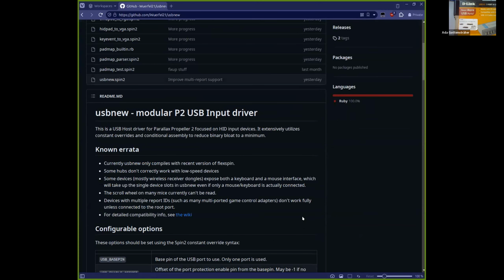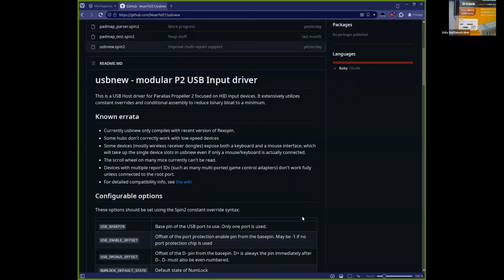Yeah, well, again, multiple game controllers make sense, multiple keyboards. You need to have a specialty use case for that. So for that sort of thing, you need to edit it a bit. The main use case for having multiple is that if you have a wireless mouse with a receiver dongle, it sometimes will enumerate as a keyboard as well, because they use the same receiver dongles for the bundled set of 1 mouse and 1 keyboard and 1 dongle. But they don't disable the keyboard interface on the dongle when they're selling it with just a mouse. So you end up with a keyboard that never presses any buttons because it doesn't physically exist, but it sometimes takes up the slot on the driver, which is kind of obnoxious. However, if you do have a combined device like that, where both the mouse and the keyboard actually exist, then it works. Such as my ever-beloved PS2 adapter.